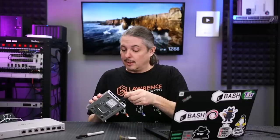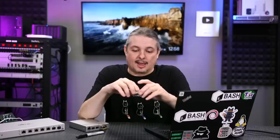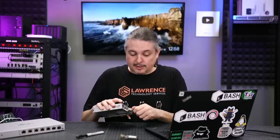I had to re-sync some FreeNAS servers, so I stuck this cable in between them and popped them in the Mikrotik switch. I'm impressed with how well the FS.com adapter worked. The other adapters, not so much — they constantly errored. They would eventually transfer when a little over spec, but with really slow speeds, constant retries, errors, and dropped packets. The FS.com adapter, even using cable not specced for this — so out of spec — was working shockingly well. I'm really happy with these FS.com ones, though I only had them running for about a week, so this is not a long-term test review.